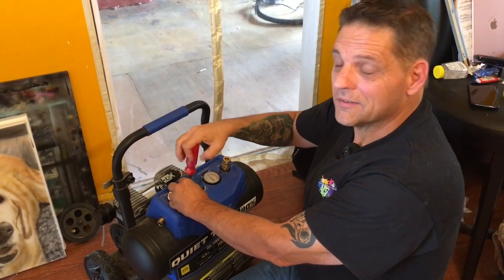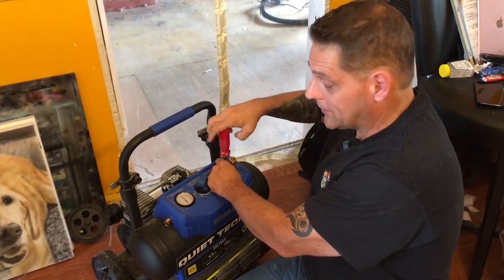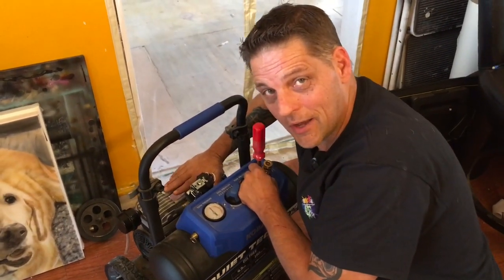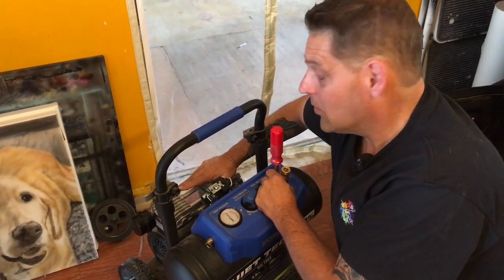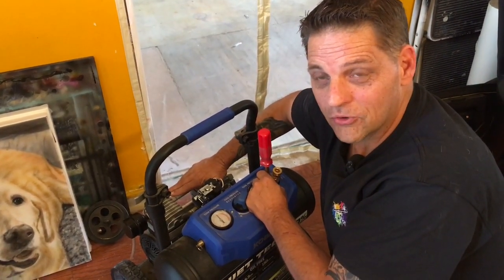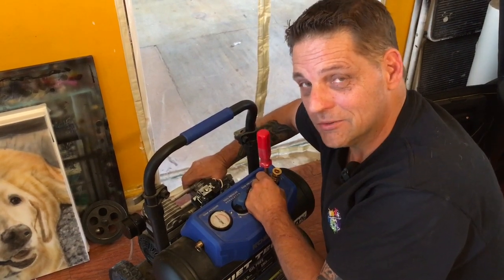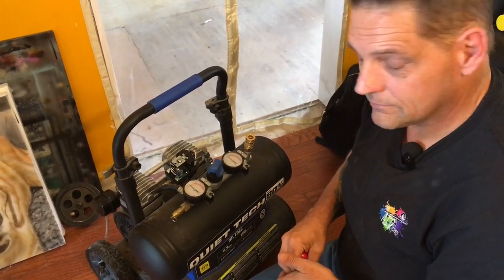Next, listen, see, and touch things to check for any rattles. In this particular case, my heat shield was vibrating against the top, so I took it off. Now the compressor has been running and I can still put my hand on top of it, but if you're getting a heavy-duty cycle, that can get hot. If you burn yourself, it is not my fault — this gets hot. Don't put your hand on it. But I already knew it wasn't hot enough. If you ran it for a long time, it's going to give you a nasty burn. This plastic cover right here — don't need that.